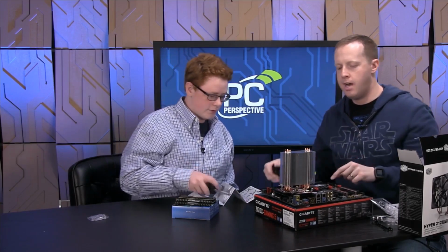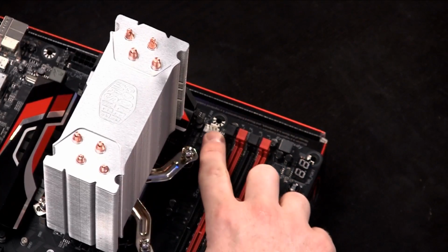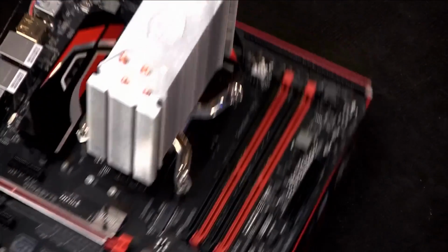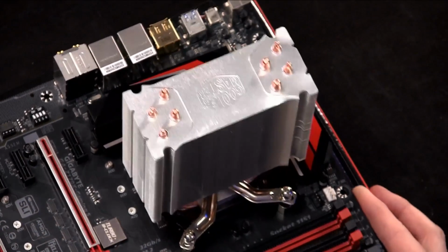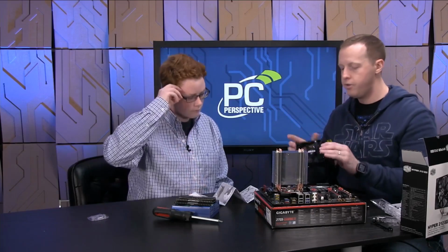If you look on the overhead shot, there are these little white blocks here. These are fan headers. You'll see there's one there. There's a black one right here. There's another one down here. There's lots of them. But this one, if you look at it, what's that say? Something fan? CPU fan. So that's the one that you want to attach to the fan that's on your CPU.